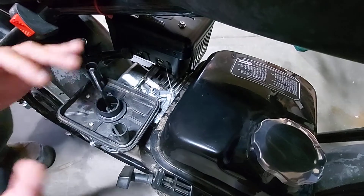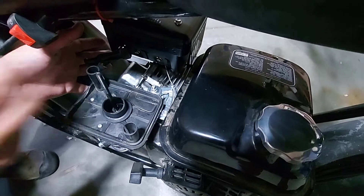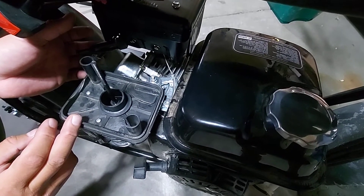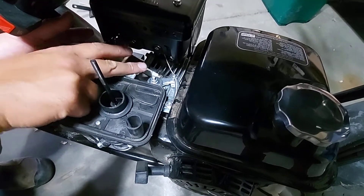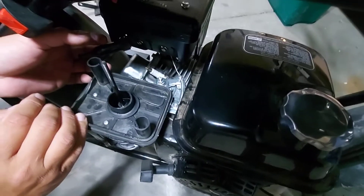Have a sponge, have a dirty rag, have something here to catch all of the oil as it shoots out. It'll do that again — 60, 70, 80 times depending on how much oil and gas and stuff is in there. Step one is you've got to get all the stuff out of the engine. Otherwise it'll never, ever start again.